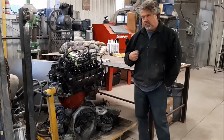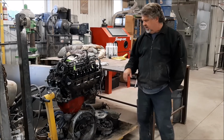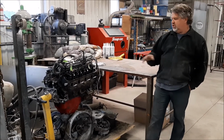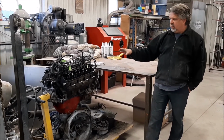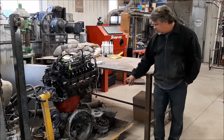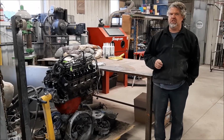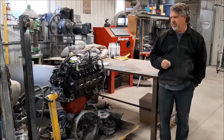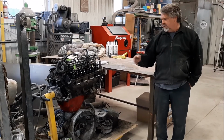In an upcoming video, what we're going to do, we'll degrease and shampoo this engine, and then we'll end up flipping it over. We'll pull the oil pan off, and we'll check the crank bearings and all of that neat stuff. So there's several ways when you use this 5-liter donor. A lot of people will use the original intake. What we're going to do is probably use a GT40 intake with the tuned pipe heads. We think it looks quite a bit better. So we've got a line on some upgraded parts, but we'll share that in upcoming videos.